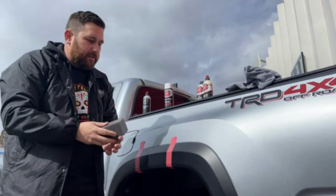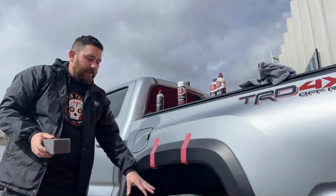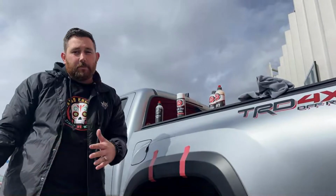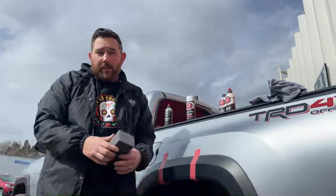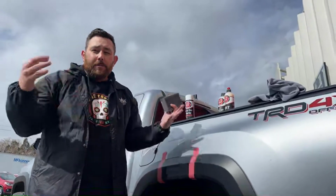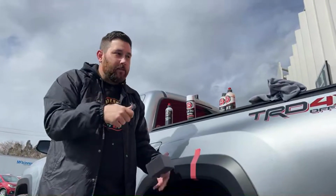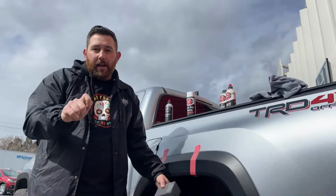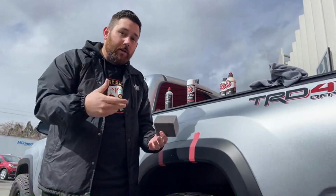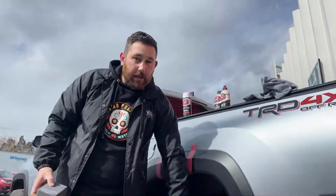The unique thing about tires is that a lot of times the brown appearance on your tire isn't necessarily dirt. Sometimes it can be old tire dressings, but like 90% of the time, it's called tire blooming. Tire blooming is essentially a mold release agent that the tire manufacturers use when they make the tires. They put the rubber into a mold, and then it has to pop out somehow. If you just put raw rubber in there, there's no way it's going to come out. It's going to stick to the mold. Think of it like using Pam spray in your cooking pans before you cook an egg. If you don't, your egg's going to stick to the pan. If you do use it, you can take it right off. Same thing with the mold release agent. But it gets incorporated into the rubber and then starts to come from the inside out, and that's a lot of times what you see, the browning of the tire.